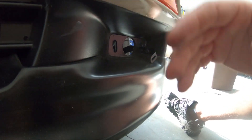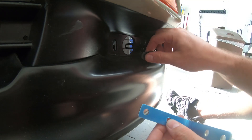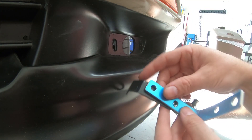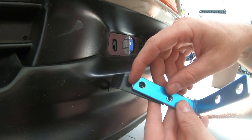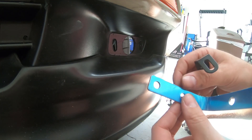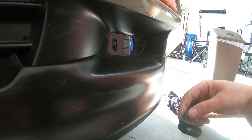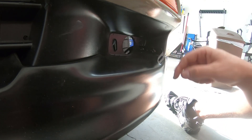Alright, this is a bracket that came with one of the cold air intakes I had bought. I basically bolted it — one of the holes lined up — bolted it in, and then back-drilled the other hole so they would line up. I kind of just roughly bent it; it already had these two holes drilled in it. So I'm making that piece I showed you a second ago — this is how I'm gonna install it and stick that arm through like so.